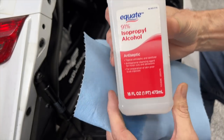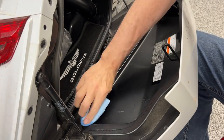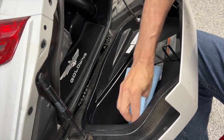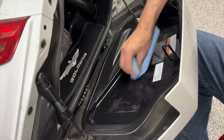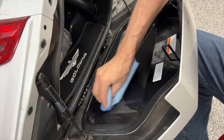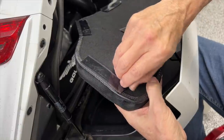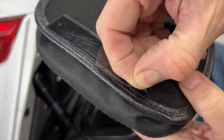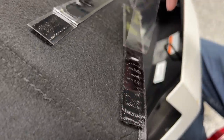Next, we want to clean the surface very well before we put anything down. I'm using some isopropyl alcohol on a shop towel, and I'm going to go over this a couple of times to make sure it's good and clean. We want to make sure there's no grease, no fingerprints, no dirt or grime on the inside of these lids so that we get good adhesion. Then we're going to start peeling off the protective backing from the velcro strips — pretty simple, you just peel them right off. I'm going to do that for all of them at the same time, since we're going to put this down all at once inside that saddlebag lid.